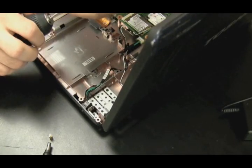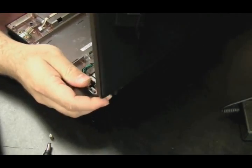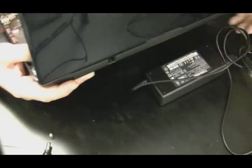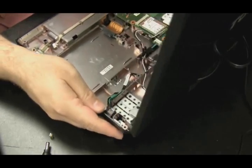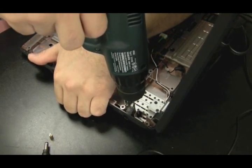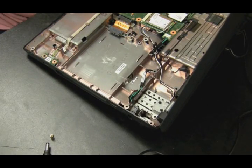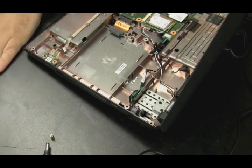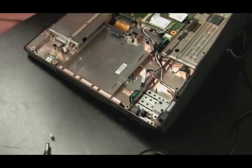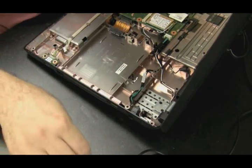I'm going to take a drill here. I put a drill bit in that's just a touch bigger than the width of that screw. You don't want too small of a hole since the standoff is threaded — you want the screw to fit gently through. But don't make the hole too big, otherwise it won't gain traction and could come loose or rip through the bottom of the laptop. The battery just died but it was enough to make a hole. I'll pull out those plastic shards so they're not jiggling around inside the laptop when we're done.